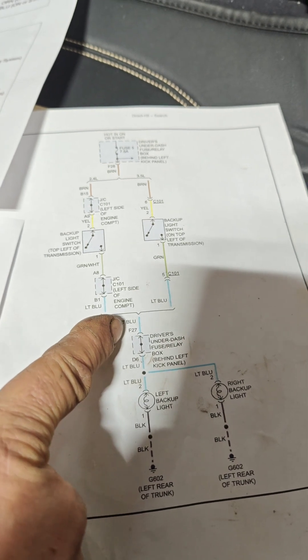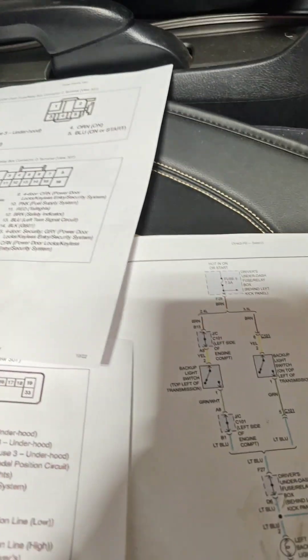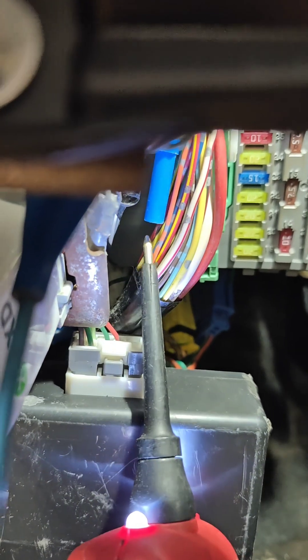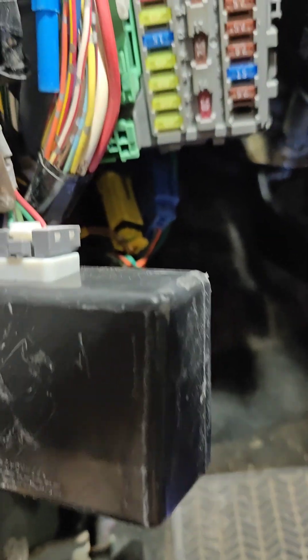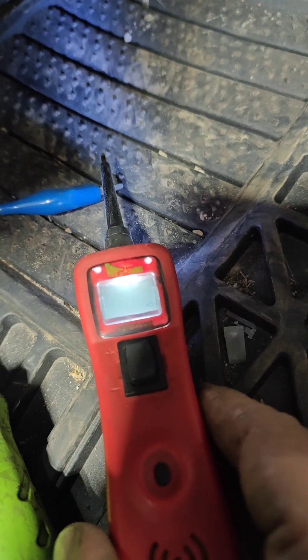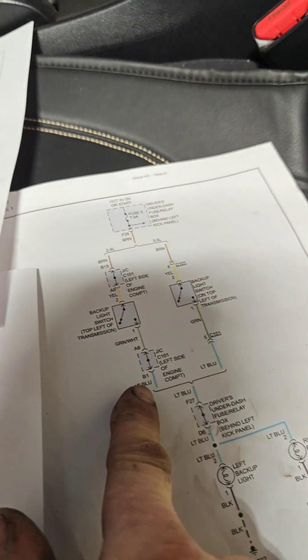F27 is the power input coming out of the switch through that fuse, which is also in this fuse box. I've got a probe into that wire and as you can see there is voltage there coming from the switch. The other one — the output circuit from the fuse box that would feed the reverse lights — when you touch this wire it's making a complete circuit through the bulbs to ground.